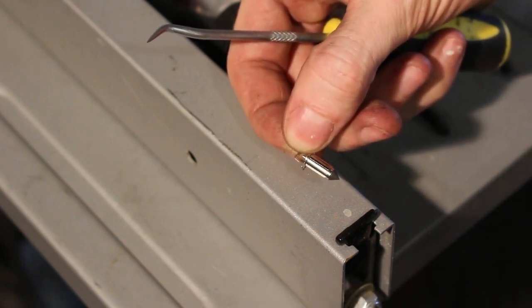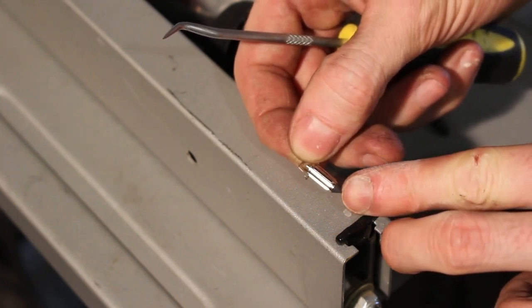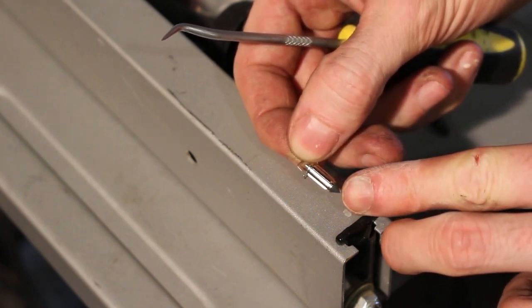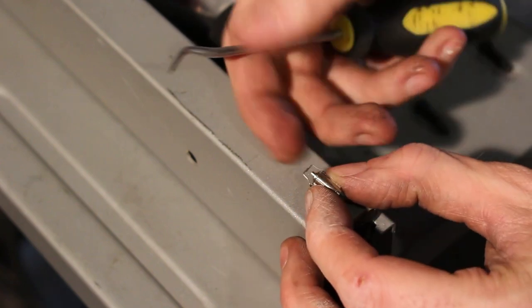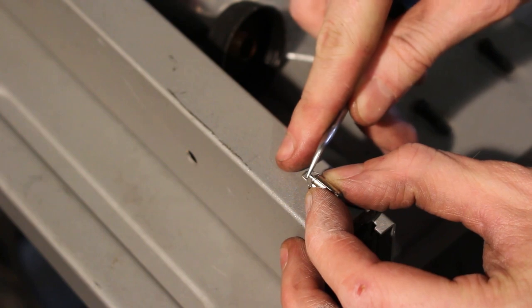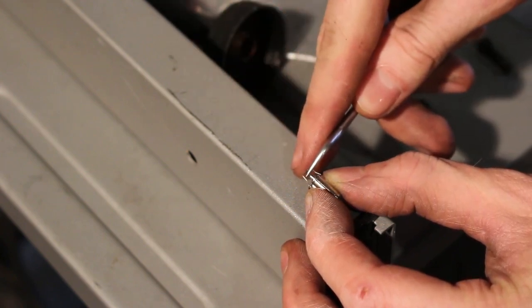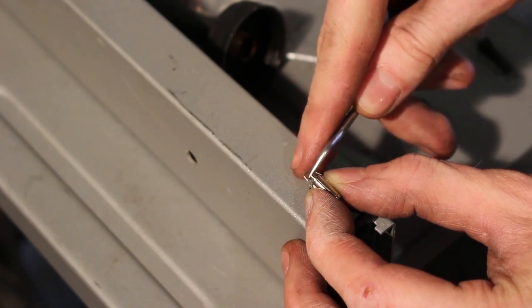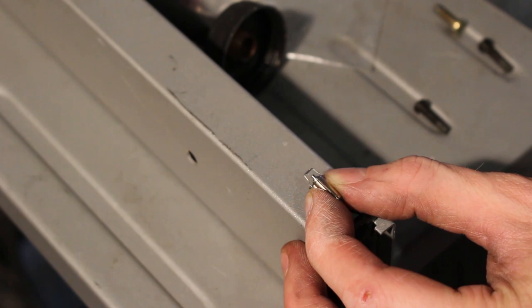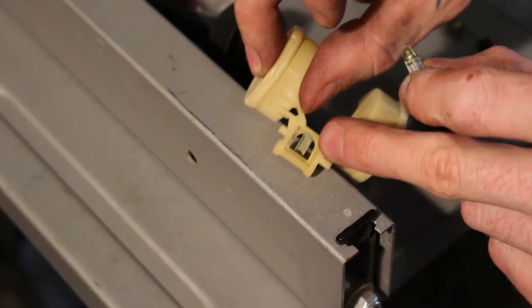needle, is what they call this. There's a rubber portion here that kind of pushes down and closes off in the valve seat. And so there's an internal spring in here. And so you want to measure the height when the tang is just touching on the tip of the spring but not compressing it. You can see here, that's what it's like when it's compressed. The tang is this portion here.